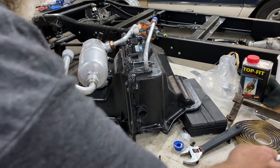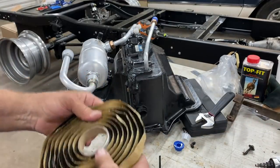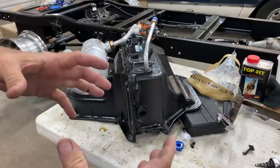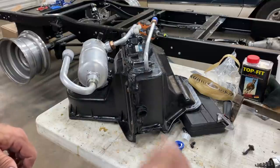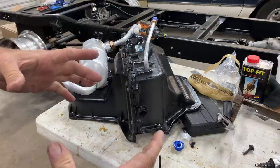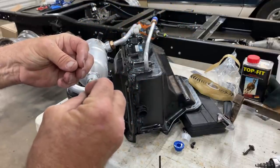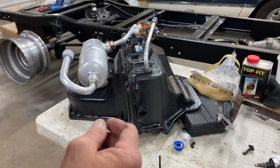And if y'all remember, me and Austin found out earlier this video exactly where our headlights are leaking from. And he came to find out the actuator is still good. We can open it up, pull the line off, hold my finger over it. Austin can't push the headlight down, so the actual baffle inside it is still good. So we need two boots that go on the other side that have to be replaced, because it just leaks vacuum out through there if you ain't got them.